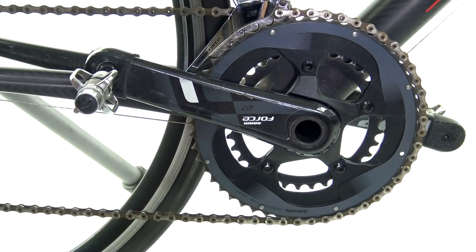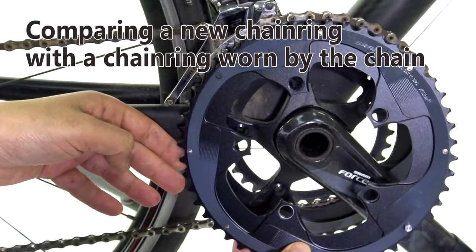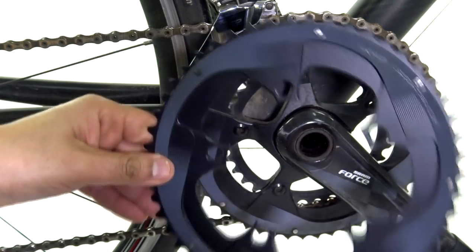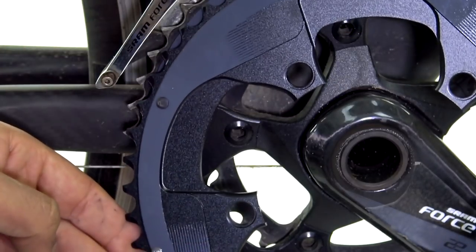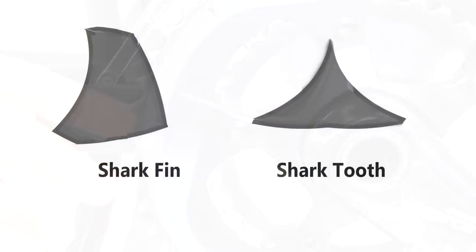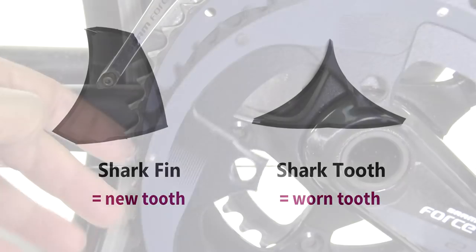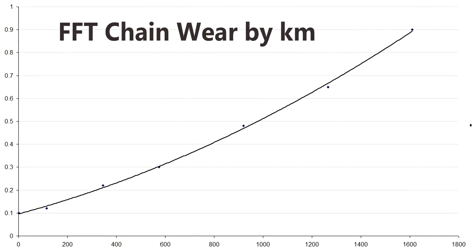And the reason for this whole video really — not only is it inefficient riding with a worn chain, not only is the shifting poor, not only are you losing watts, but you're wearing your drivetrain down. You're wearing down your chain rings and your cassette. It goes from a shark fin style tooth to a shark tooth — pointy in shape. That's what you're doing to your drivetrain: putting excessive force through it and accelerating the wear. It's not perfectly linear — the wear goes up with time. That's everything I want to tell you about chain wear and the little calculator which you can use — link below.